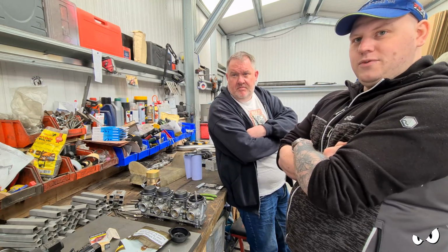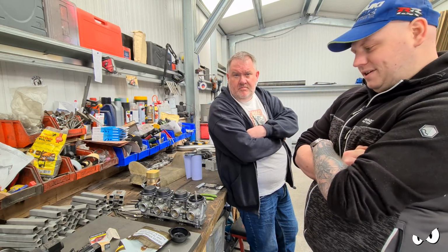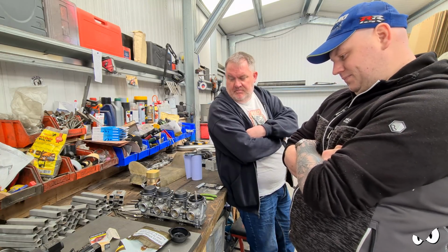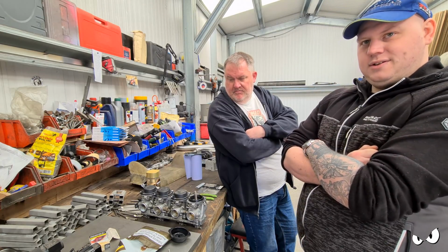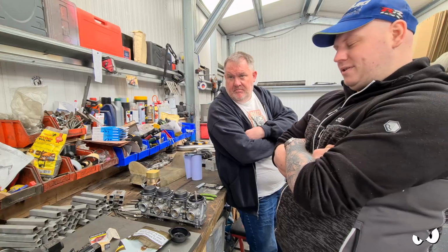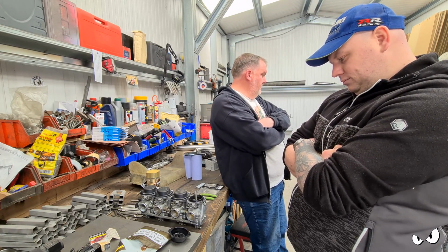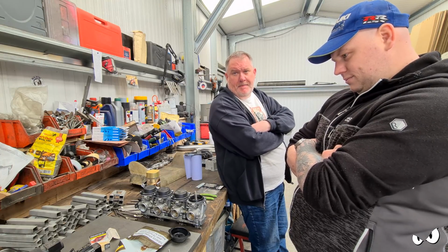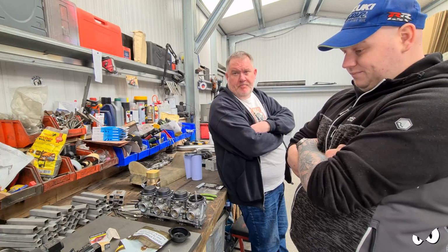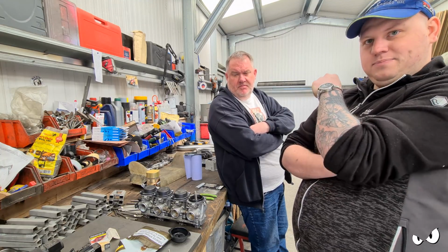Well, there was weird everything. A really small main jet and a really big pilot jet, which don't look standard either. I think the pilot was 37.5, which I'm not sure is right. But again, whatever was running on the wave, it doesn't make sense to have those size jets either, does it? If it's massively big, then it ain't gonna run. Or well, no, it probably would on tick over, but once you open it up.